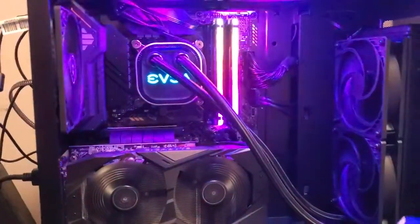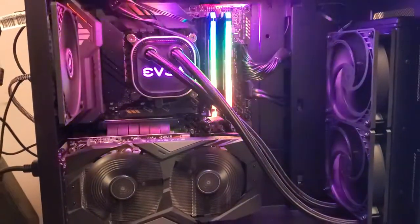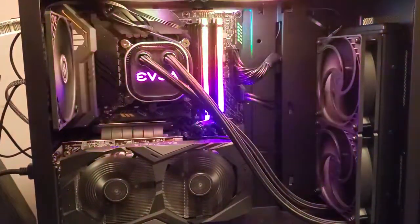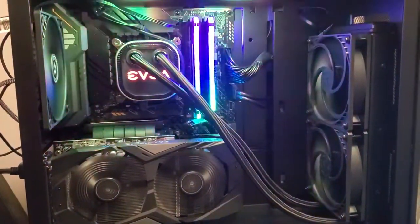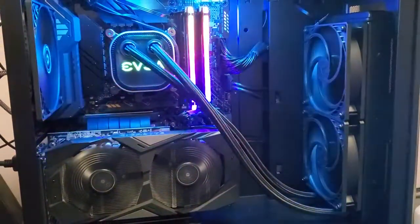Here's an update for the 10850K system. Intel replaced the CPU with another 10850K, which is perfectly fine with me. I went ahead and swapped out the 10100 and booted it up. I'm currently running it at 2133 for the RAM.